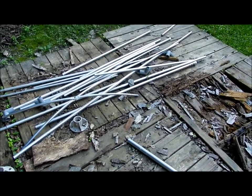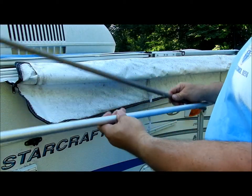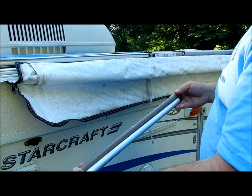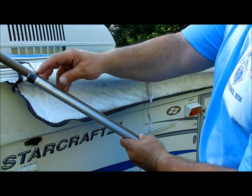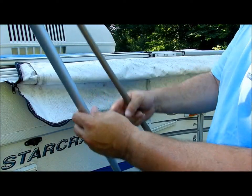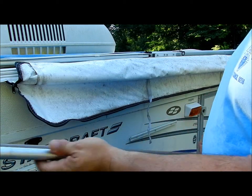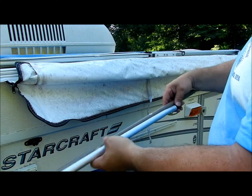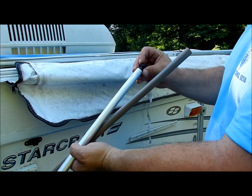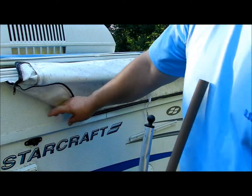Back to the repair of the awning. Before I do any kind of cutting of this pipe, I'm going to find a part of the gazebo pipe and cut it to the exact length — shiny part to shiny part. I'm going to cut the new piece before I do any cutting of this to get the ends off. All we can do right now is pray that these fittings on the ends are actually going to fit in. I'm going to have to file that down because that's pretty sharp — that's the ball that goes into the mounting part right there.